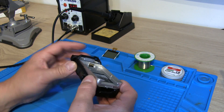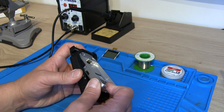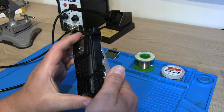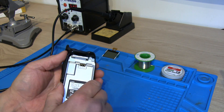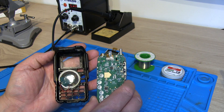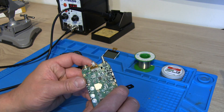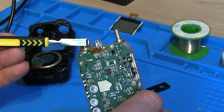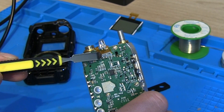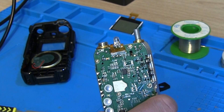Something to be aware of is that just behind the speaker mic attachment is the little plastic panel which can fall out, so you just need to gently bring that out. The speaker would normally be connected too, but I've already disconnected it from last time, so the speaker is left disconnected. And you can see where that ripped ribbon cable is just here, just underneath the LED — we need to desolder that remaining part of the ribbon cable, then clean it all up and reattach the new screen.